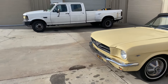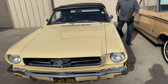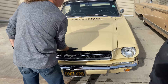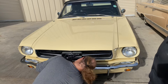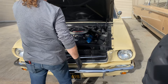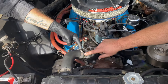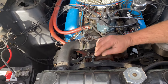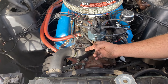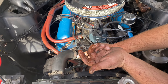Unless they wanted 100% power force, they always do the Gano filter. See, there's the Gano filter right there, and it has a screen that's kind of bowl-shaped, so it flows out through the thermostat and all the schmutz gets caught up in there in the filter.